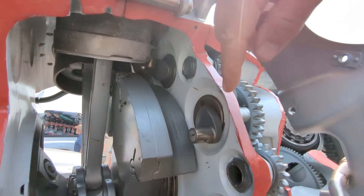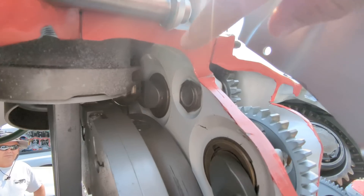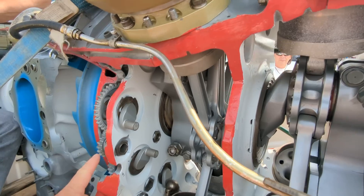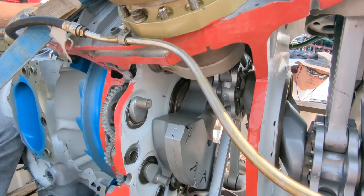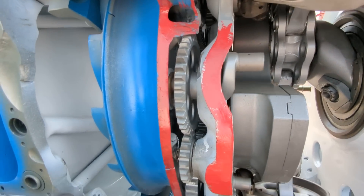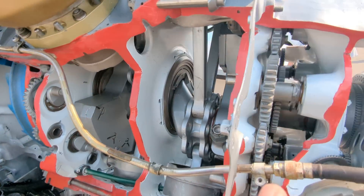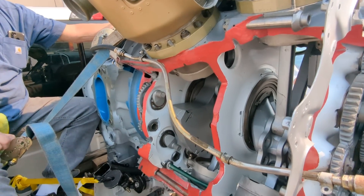You come all the way down here to the sleeve-valve actuator. These cylinders are missing in the cutaway view, but up in here you can see the sleeve-valve actuator grabbing hold of the sleeve-valve. You see the pistons going up and down, you see the crankshaft turning, but you also see the sleeve-valve actuators rotating as well. The way those sleeve-valve actuators actuate, it allows the sleeve to rotate and go up and down. All of this is actuated by a whole bunch of gears on both sides of this engine — two rows of cylinders separated by a large main bearing, the crankshaft working through, and two sets of gearboxes on either side that maintain the sleeve-valve rotators.